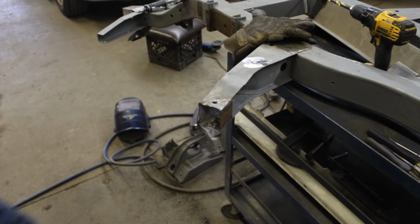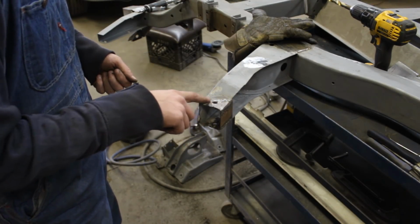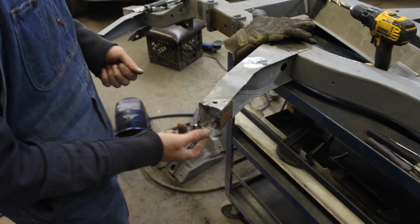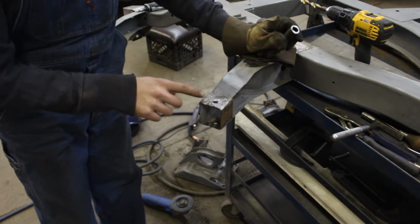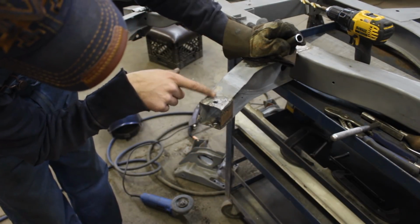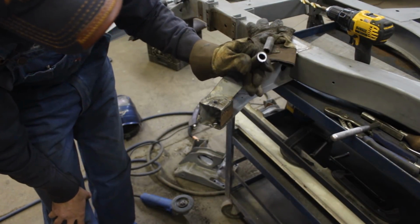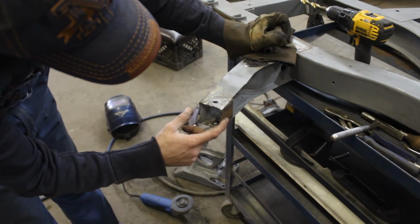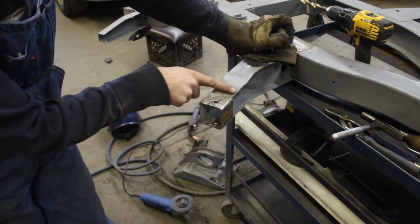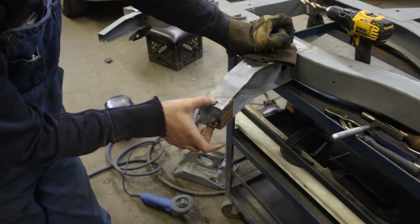Alright, here we said we need to have a nut underneath. I'll go check online to see what's coming here, because that might be a long bolt actually, and there shouldn't be a nut there. We will see. Let me check. Okay, so it turns out there's a long bolt that goes from the body through the whole frame and comes out on the other side, and there must be a nut here on the other side which is not welded to the frame. But I'm worried a little bit because this can be easily squeezed from this bolt, or if someone jacks the car up here, this is gonna squeeze and this bolt is gonna loosen.